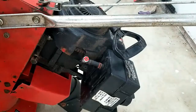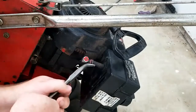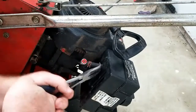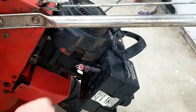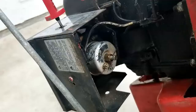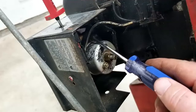I've tilted the snow thrower over on its face so I can access the fuel line and shutoff valve underneath the gas tank. We're going to remove this clamp here, which should allow us to take this hose off. Then instead of finishing removing it from this side, I'm going to go to the other side and disconnect it from the carburetor. The hose runs through and meets up with the carburetor in the back.